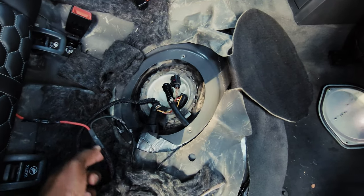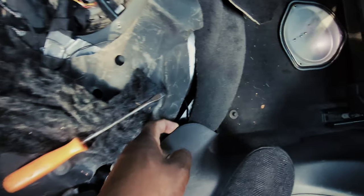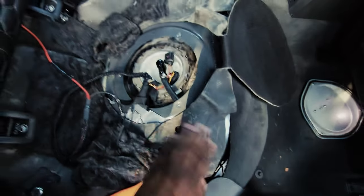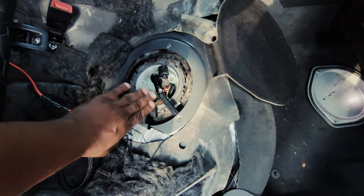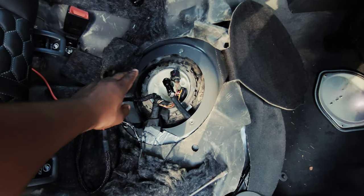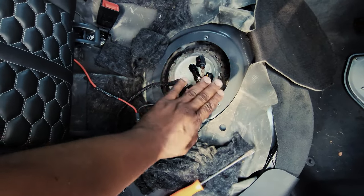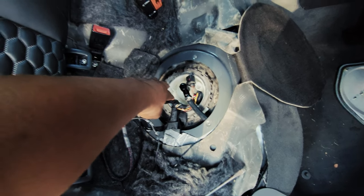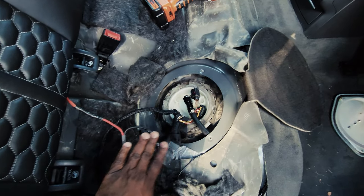The wiring here is from Radium Fuel. It runs to the battery and the negative ground goes underneath. It wires up to the pump and goes to the boost switch in the engine bay. That switch runs off vacuum and turns the fuel pump on at 2 psi — it's a dumb boost switch, just reading boost and turning the pump on. That's why you need to get a DSG tune and tell the car this pump is here, so everything works together in perfect harmony.